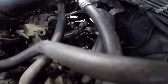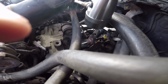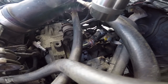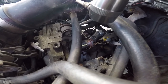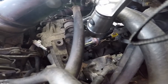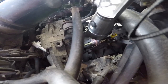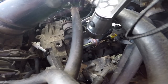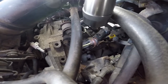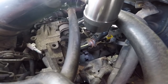Out front I have the adjustment cranked almost all the way down. I'm putting the lock nut on there just to keep it from moving, and as long as it makes it home I don't really care. If your clutch doesn't fully engage when your foot is off the pedal, loosen this a little bit. If the car still won't go into gear and just grinds when you push the pedal down, tighten it a little bit. That's pretty much it — hope this was helpful. I know it wasn't very precise, but hopefully it gives you more guidance than what I found on YouTube. Thanks for watching, have a good one.